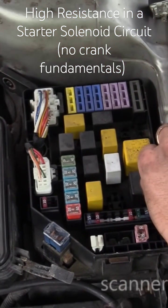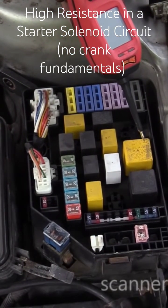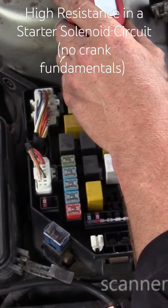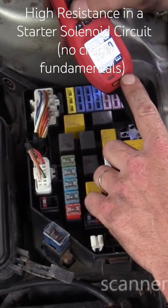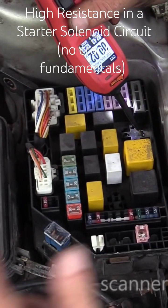Let's see if I can make it crank. Let's get this back on there. This power probe is also going to show me a ground path on the tip — see, the light's green now. If I load that... see, it went away. My ground went away. So once I loaded that circuit it was enough heat to open the circuit back up.